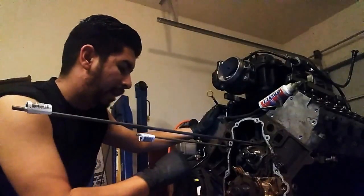Because once you remove the whole VVT — if you guys haven't done that yet or don't know how to get to this part, check out my other videos. Slowly turn the cam as you pull it out. You don't want to pull too hard, because you don't want to take out your cam bearings.